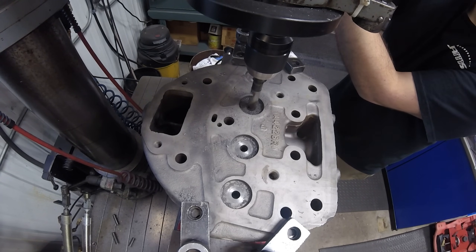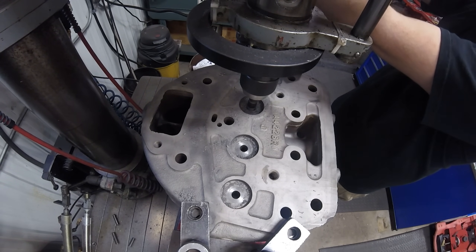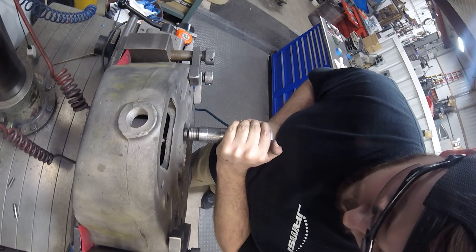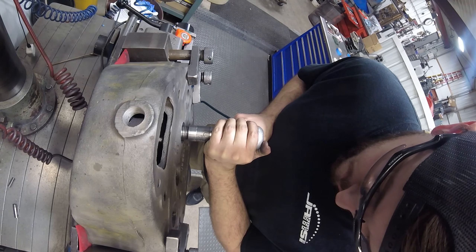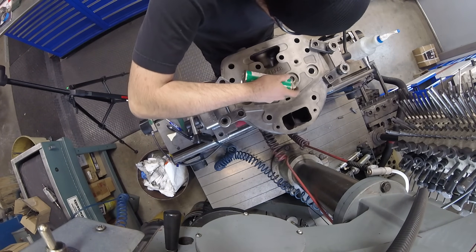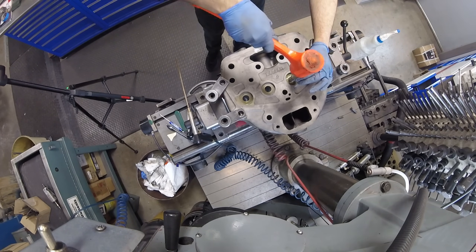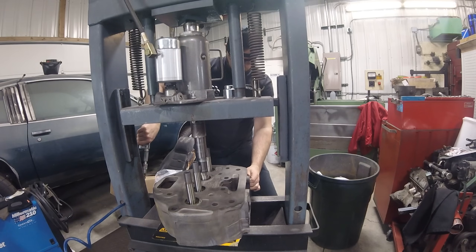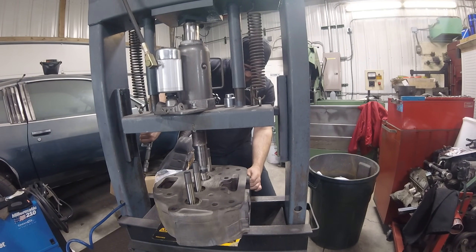With the guide cut flush to the spring pocket, I go in with a drill bit to drill a center section of the guide out about three-quarter to four-fifths of the way to the bottom of the guide. This can help relieve some of the press in the guide while still leaving a step to get the air hammer on and drive it out. I then like to get the guide started straight with a rubber dead blow hammer before moving over to the press. I've already determined the correct guide height through comparing measurements and specifications, and have used various spacers to create a stop to press against for the guides to come out at the correct installed position.